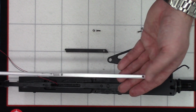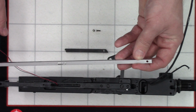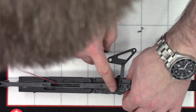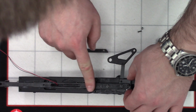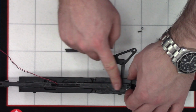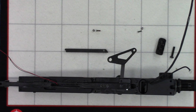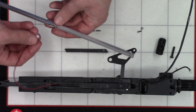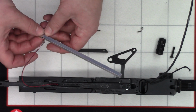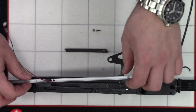Next up, we're going to reinstall this little aluminium channel. First of all though, we're just going to put a small amount of lithium grease on the top of the rail, or the bottom of this part. Just a small amount will do. Using lithium grease in this instance, as it's not really a high wear item, just wants a little bit of grease to take off that metal on metal feeling. Next up, we'll take our channel and fish the wire through this part here. Nice and carefully, like so.